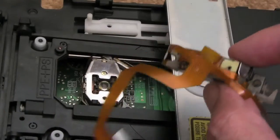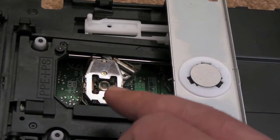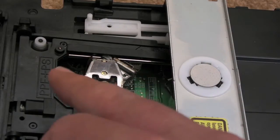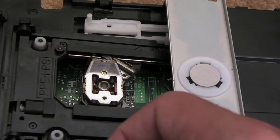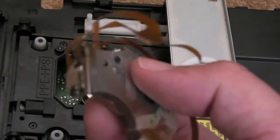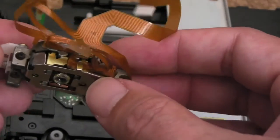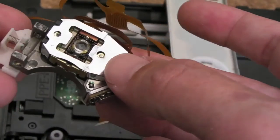This was my first port of call. I thought, okay, it's not working — you put a disc in, it doesn't spin. The laser assembly moves up and down, the focus goes up and down. You can see the laser moving up and down doing the focus adjustment. All the signs in terms of the logic controlling the head assembly — moving it up and down, moving the laser up and down — all seem to be okay. I did suspect it could be the BTL driver chip. Motor was okay, I tested that.